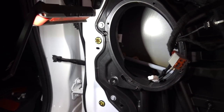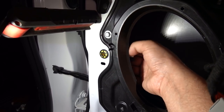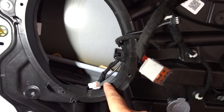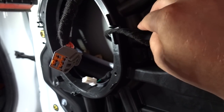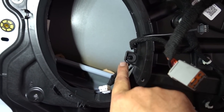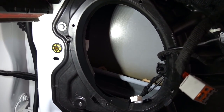For the wiring inside the door, I followed the factory wiring as it came out of the harness and zip-tied it along the bottom of the speaker bucket. There's a little provision where another factory wire comes out, so I just tucked my LED wire in there beside it and put one more zip tie on the inside to anchor it — just so everything stays in place and doesn't get caught on anything when the window regulator goes up and down.